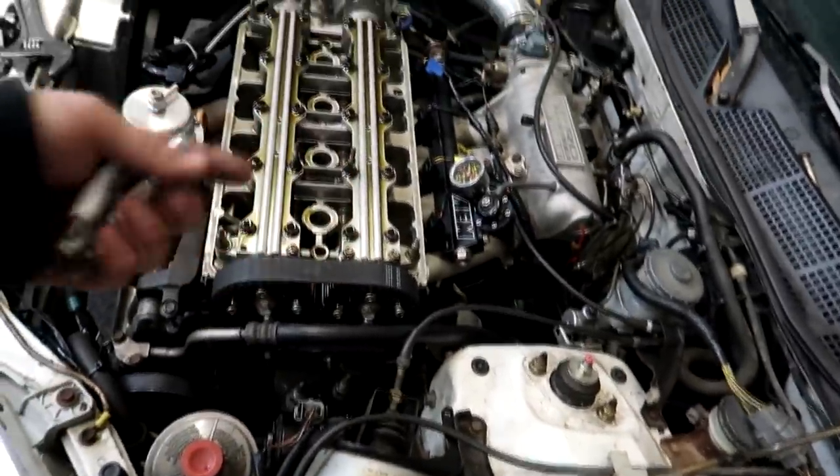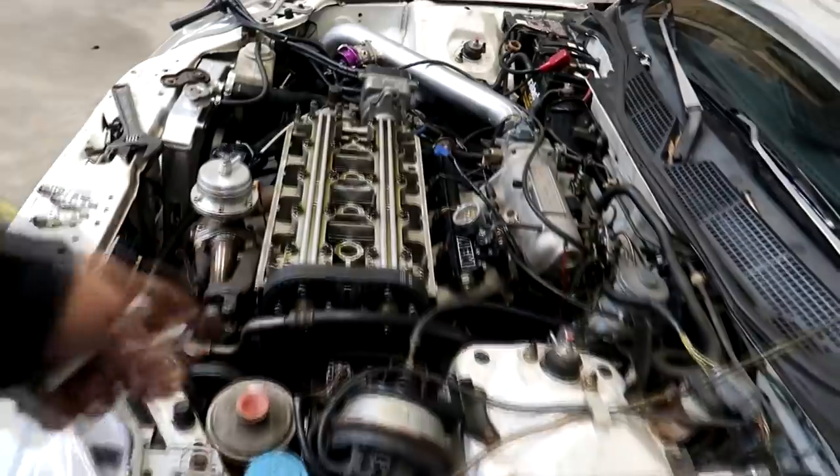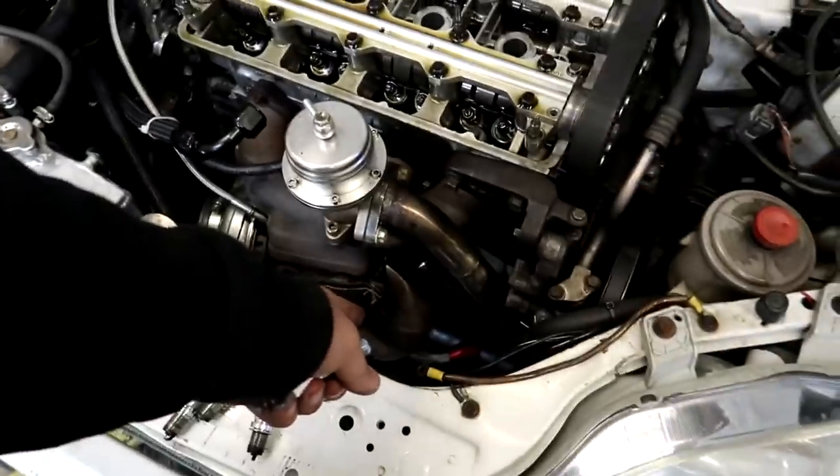They should run okay without having VTEC issues at zero, but we may have to adjust the cam gears. I'm going to throw these plugs in and run through this again. The big problem is this big camshaft isn't really going to want to go through that tiny downpipe — it's got like a 2.5 inch to 2.25 inch downpipe going to a full exhaust that's like 2.5 to 3 inch with a muffler and resonator. So it's definitely going to be choked up, and it's on pump gas.